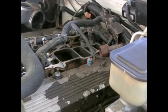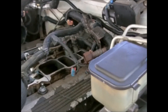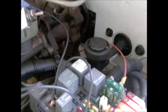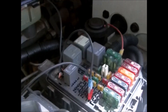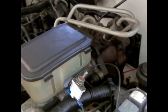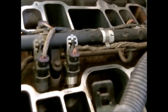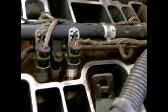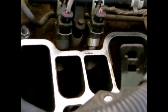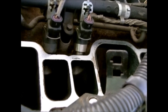The way I tested it was I took the intake plenum off. I made a little temporary switch for the fuel pump relay with a fuse, so I could pull the plenum off and see the fuel injectors while they were still hooked up. That's awesome about this design because it keeps me from having to pull the injectors out individually. I can test them with the fuel pump in the truck, pressurize the fuel injectors with the engine off, and see which ones are leaking.